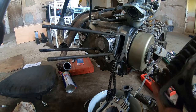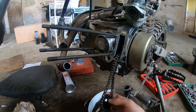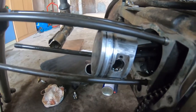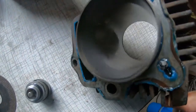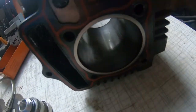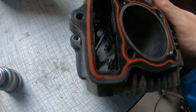Here's our cylinder — it's a little bit scored. I'll show you better. The cylinder doesn't feel good. It does feel bad in this spot right here. There is a bad spot in it. I don't know if that shows on camera, but there is definitely a bad spot. So I think we should at least hone this thing.